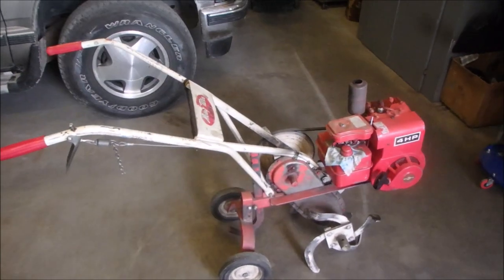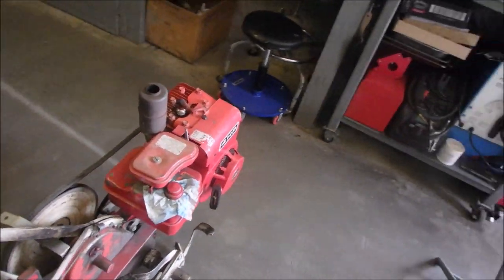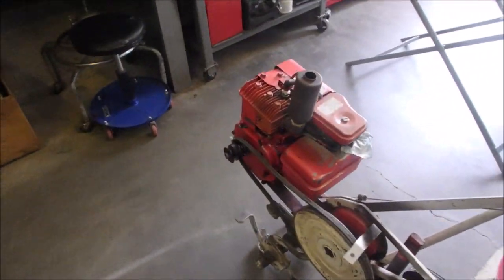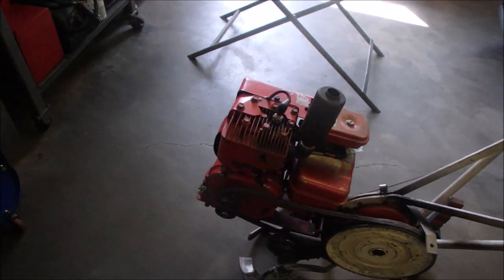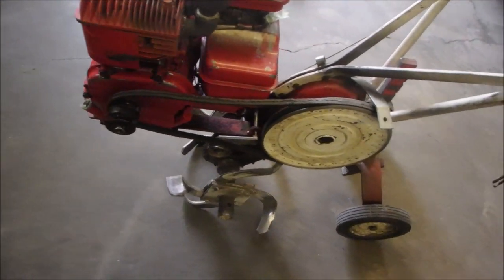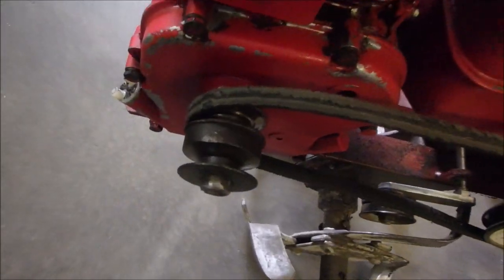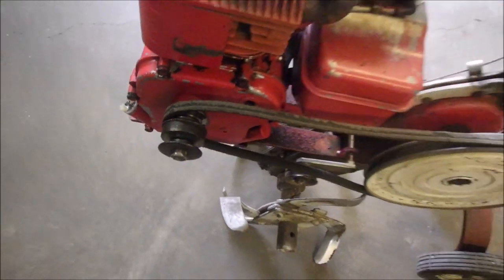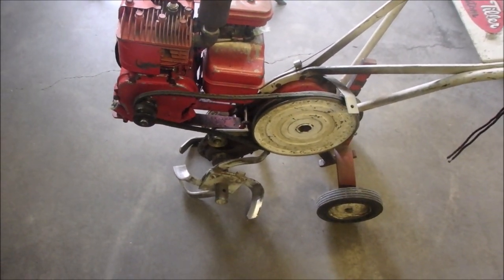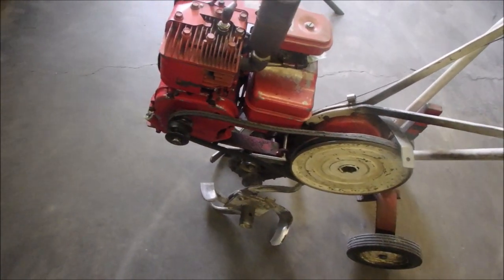It's a 4 horsepower, 1969, and I remember this. I did not have even a non-electronic coil that'll fit because it has a bigger distance between the flywheel and the adjustment. And also, the belt is non-standard. Somebody has put on a smaller pulley on the front to give it more power, and they've just put a belt on there that'll fit, and it's off-standard, and I really am not sure what to do there. But the problem is not that.